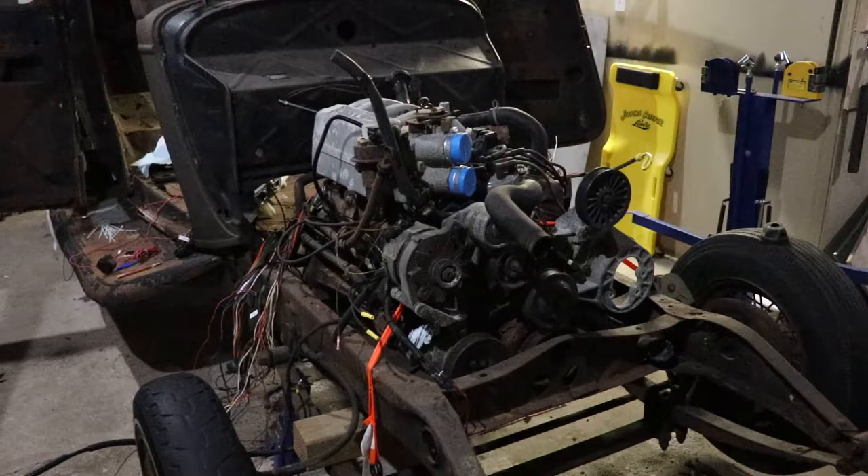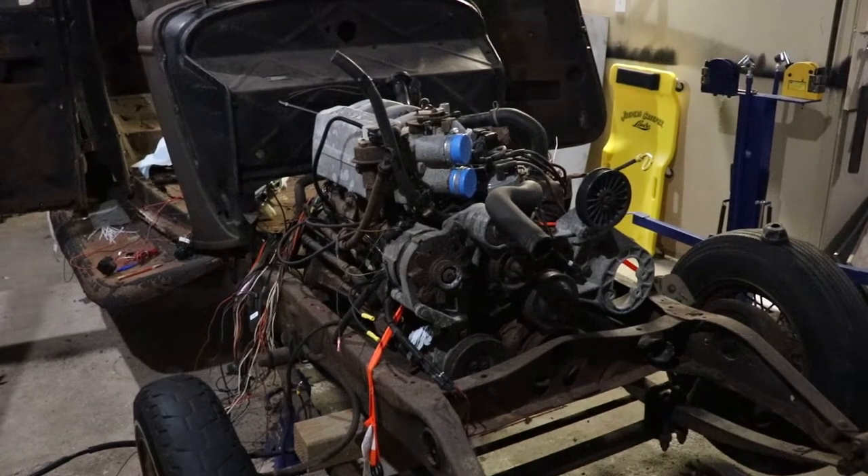There are a few things you want to keep when you get the whole vehicle together. You want to get the charge indicator — that's one thing I did not keep but probably should have, as it would have made things easier with the alternator. You want to get the gas pedal and both fuel pumps. There's a high pressure pump and a lift pump in the 5-liter vehicles. The high pressure side uses a Bosch pump and has a metric fitting that's hard to get a proper hose barb for. You'll also want to get a bunch of wiring.